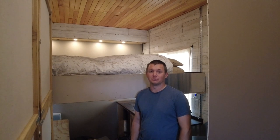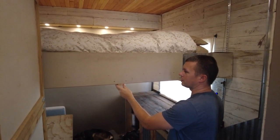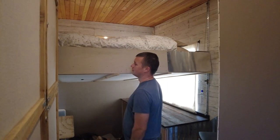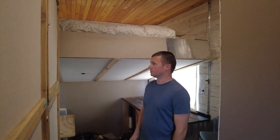Our bed system functions very similar to some windows. In a house you have windows that raise up and down — older ones would use counterweights that weigh the same as the window, so you'd raise it up, let go, and it stays. It doesn't fall, it doesn't go up any further. When the bed's not on its supports, it just floats. Newer systems use constant force springs. We didn't want to add weight to the trailer just for the sake of holding the bed, so we chose to use constant force springs, which means no matter where I let go, it stays. It's counterbalanced without actually having extra weight added for the purpose of counterbalancing it.